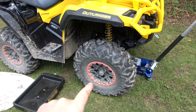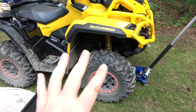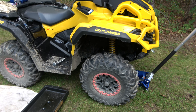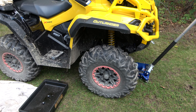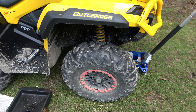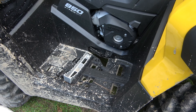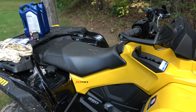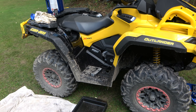Some people like to remove the front tire to give a little bit more room — you can do it both ways. I'm going to go ahead and remove my front tire to remove my trail wheels and then put the factory wheels back on. Removing the front wheel is completely optional and up to you. All you'll need is a 15-millimeter socket for the lug nut and a 15-millimeter socket for the drain plug, plus a funnel. The manual says this machine takes 2.1 quarts of oil.